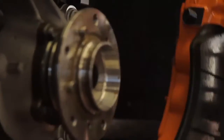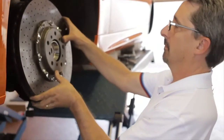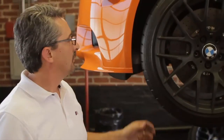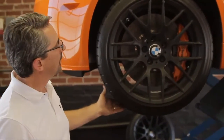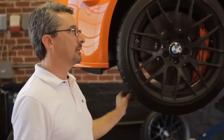We're going to add a little touch-up and we're ready to install. We've got the wheel back on it. Looks like we've got enough clearance in between the spokes and the caliper, which I'm real happy about. And our balance weights as well aren't interfering with anything, so I think we can bolt everything up to the proper torque. Get the brake hoses on and we'll bleed the brakes. We wait until we get all four calipers installed, or one at a time? That might be a good idea.